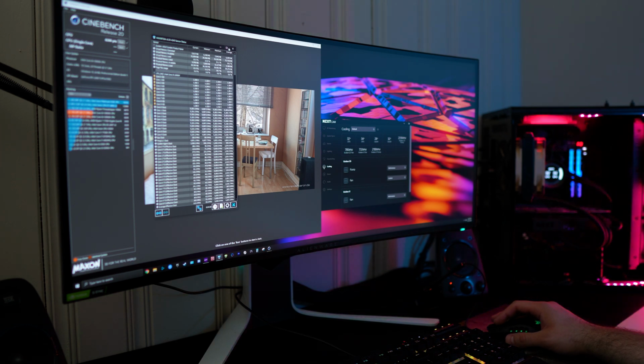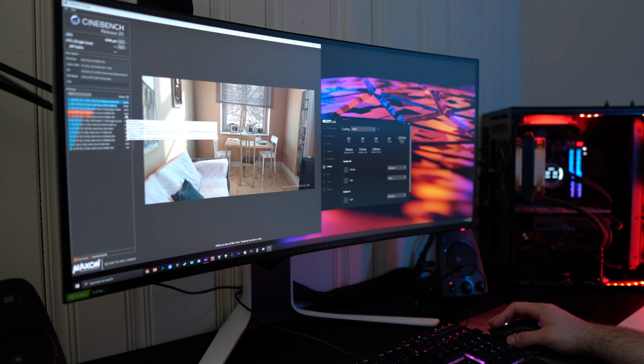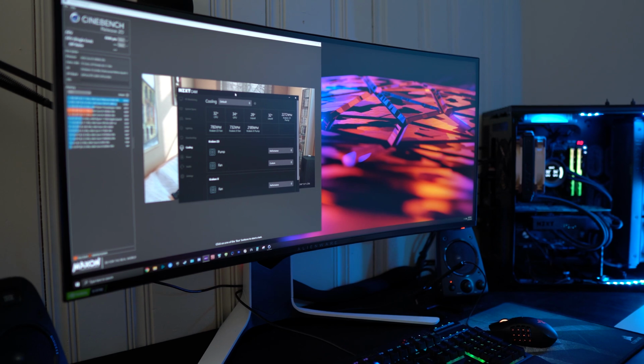Yeah, it's working fine. I got 6280 points. I did get more points. I think I got 6500, but I think I changed some settings, and I think I was at 5.3 gigahertz. So there's that. But I think I was also hitting 80 something Celsius as well. So I'm okay in the 60s, honestly. I'm back idling at 32, 33 again. I'm okay with that, just to lose 300 points in Cinebench. That's fine. But yeah, that's pretty much it.